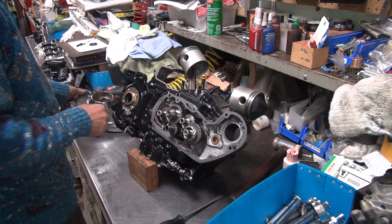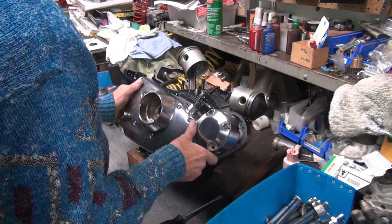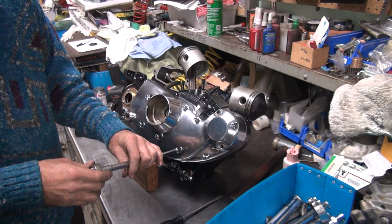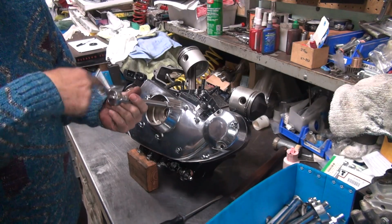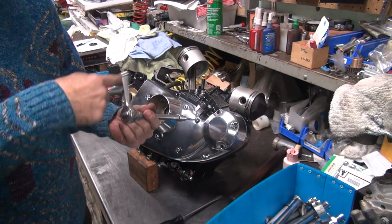Okay, so I'm going to put the cam cover on it without a gear on it one more time, and make sure I can turn that thing at least 10 times without binding. If it does, then I know it's the idler gear that's the problem again, and go get another idler gear. Maybe we'll get one that works this time.